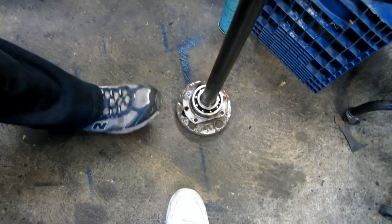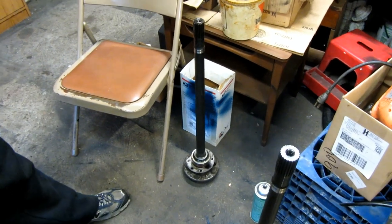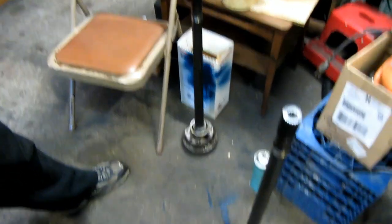This is the bad one. How much pressure, mechanic Mike, did we have to apply to get that thing off? It was like seven tons or something. Yeah, we had a 20-ton press and I saw the gauge go up — it was a bit scary there, a little tight. This one is on backwards; you can see the grease seal. They thought the grease seal was on the outside.